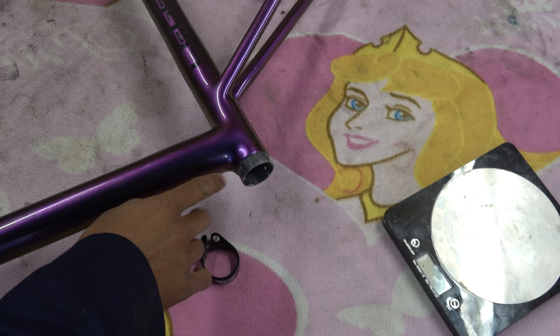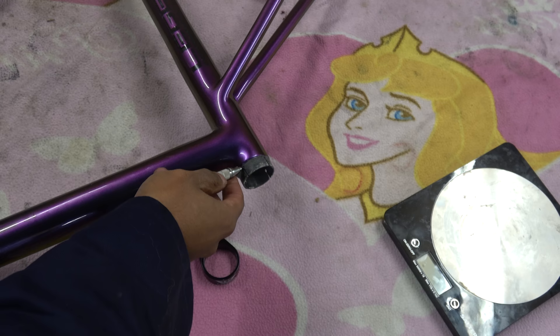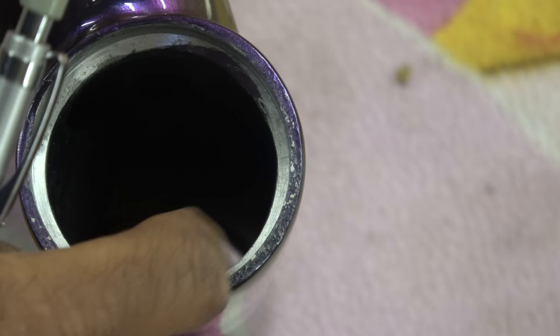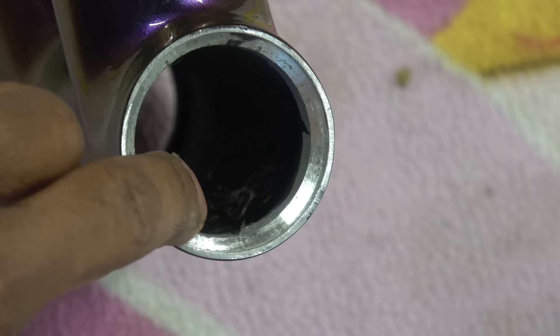This is the seat clamp. If we take that off, some of the slips that have been put in are not particularly straight - they're off on the piss. The holes are really, really quite poor and the finishing - you can feel some of the fibres left over. This is the lower headset bearing. The thickness on there is really, really small compared to down here where it's comparatively thick. It's not concentric, and the finish on here is atrocious - I'd be ashamed of that.